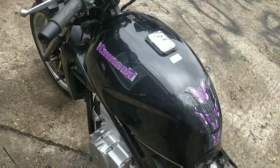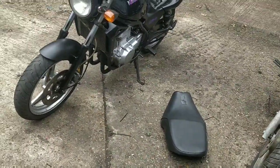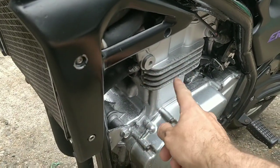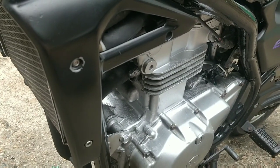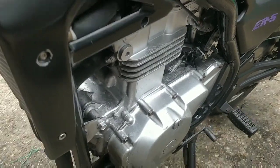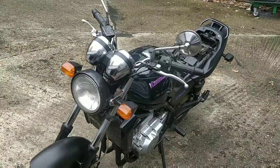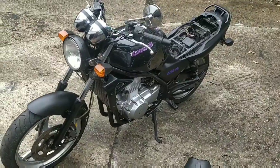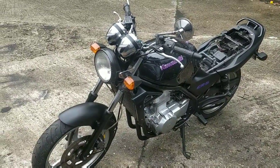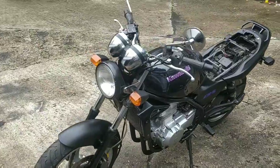I'll leave it idling a little bit. It started straight away, so I do think the battery was a touch low. The next step is to give it a run - idle it for five to ten minutes then give it a run. Down here there's a little bit of spill; it's not fuel, it's coolant. I'm not sure where it's coming from, it's quite intermittent but it's not a lot - I think it's an overflow thing, nothing to worry about.